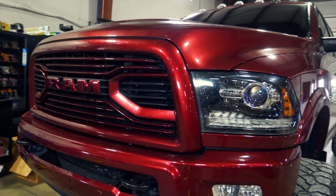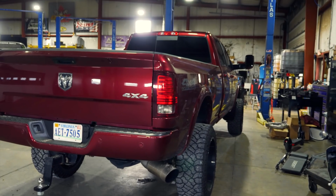Hey guys, we've got Jeff's 2018 truck here. We just got done doing a 48 swap on it, and I'm going to let him tell a little bit about the truck, what your goals are for it, and what transmission you put in it, and why. All right, so I think it's not a secret that the 68s aren't the best transmission out there. This truck's only got 30,000 miles on it. The previous owner burned up the stock transmission and put in, I guess, a Comp 2 transmission with billet shafts, the Sonnax drum, and all the goodies that are supposed to make it last. That didn't last, and I'm not going to keep putting something in there that could potentially fail.